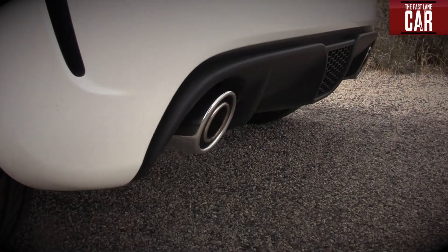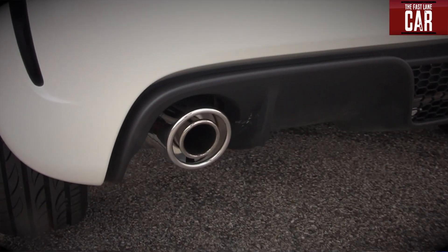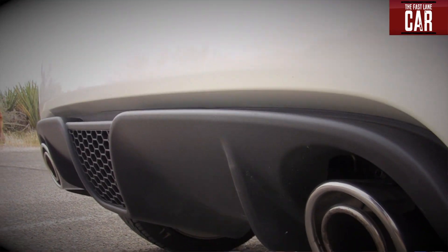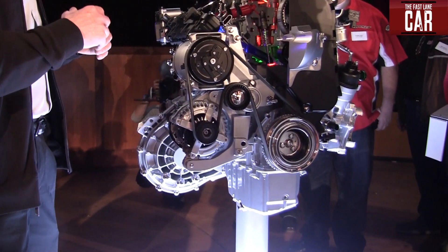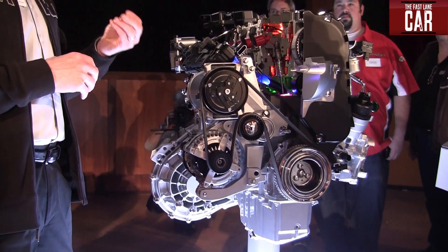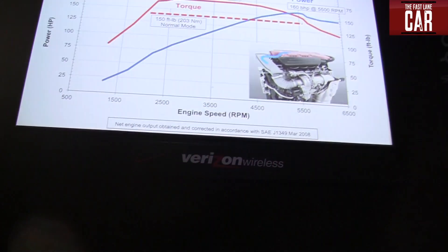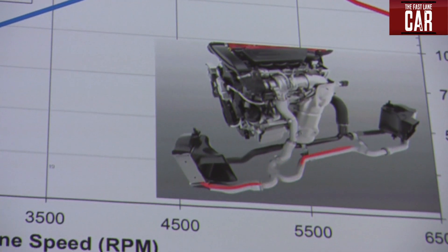There are actually five different modes of control we can utilize. Under high performance conditions, we follow the intake cam profile completely — that's called full lift mode. When in part load conditions to optimize fuel consumption and reduce emissions, you can utilize early intake valve closing, where you start to follow the cam lobe and then close it. Or if you're in very low speed operation or idle, you can have late intake valve opening, controlling the timing and lift of the open.